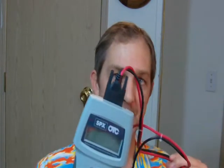I'm also going to be showing you a clip using this digital battery tester. I'm doing it kind of slow so you can actually read the menus and understand how it works. With the traditional tester, if your battery is 500 cold cranking amps you're going to want to pull 250 amps, and a good battery won't drop below 9.6 volts. When it does that you get a rotten egg smell and your tester starts heating up — and that tester is very expensive. I think this digital type is the superior way to go.